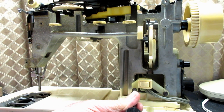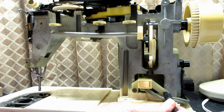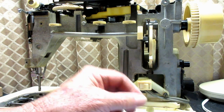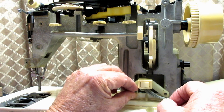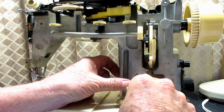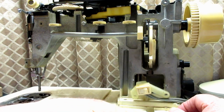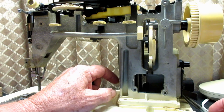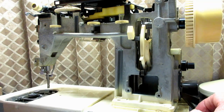Since it's on the front here, it's just two screws right here. You can take pictures of this process on your machine if you're doing this yourself. Remember to keep your screws separate and labeled, because some are interchangeable but many are not. When you go to reassemble, you'll need the right screws in the right place. Stick them in little ziplocs or use an egg carton — especially paper ones, where you can write on the lid.